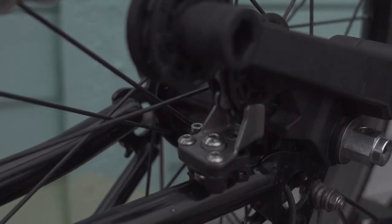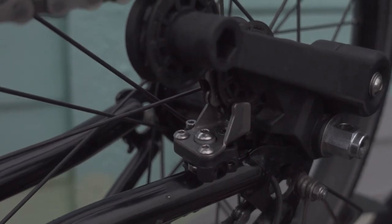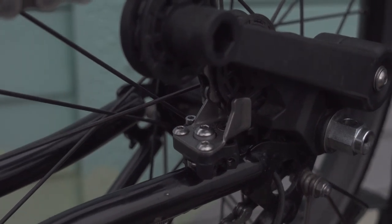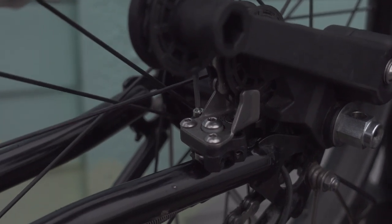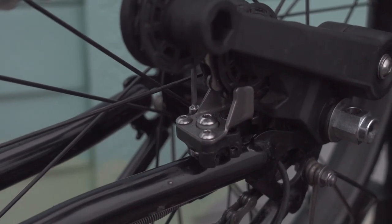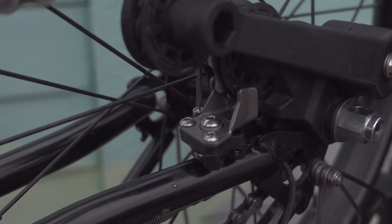If once you've cleaned your chain tensioner and made sure that your chain pusher is clean you're still having problems with changing gear, you might want to check whether the dog leg is done up too tightly using a 2.5 millimeter allen key. The dog leg shouldn't be too tight because it will inhibit the movement of the chain pusher, so you just want to slacken it up slightly to enable the dog leg to move.